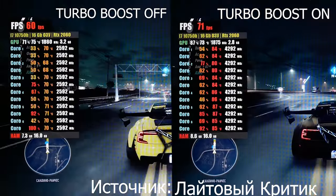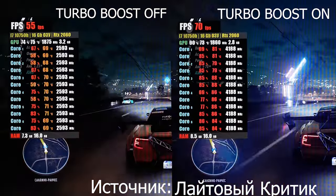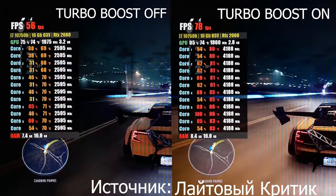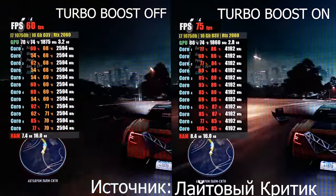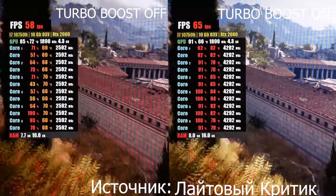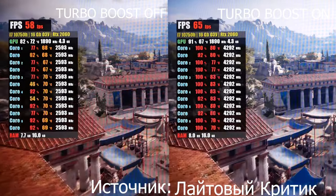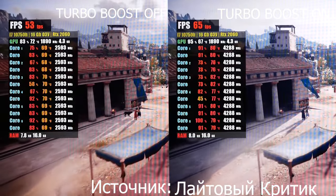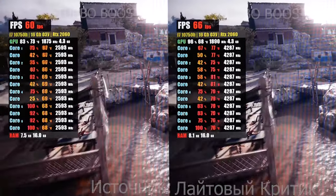As you can see, the FPS loss can hit even 30 FPS. But if you have a laptop that always overheats and has thermal throttling, the only right approach is to disable the processor's turbo boost. In these situations your laptop was made with a very weak cooling system that is unable to reduce overheating. If you don't disable turbo boost in situations like this, your laptop will likely fail because of overheating. Even losing 30 FPS in games is better than losing your gaming laptop entirely.